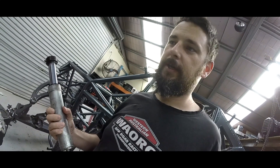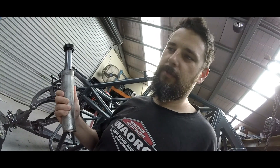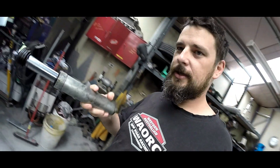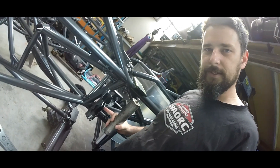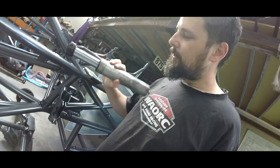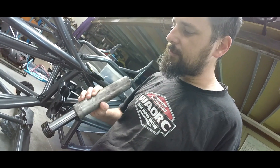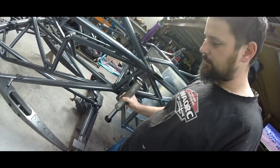You can buy them in different stroke lengths. However, these are some old ones that I had which I'm reusing, and these are 4 inch stroke — okay, this is the stroke here. These get mounted in what's called a bump stop can or canister, which is this thing here. It's just got 2 bolts and it pinches up nice and tight. There's a lip just here so when the bump stop sits up and this is pinched up, it sits on that lip so the bump stop can't go up anymore. On the rear, 4 inch stroke — no problem at all, not an issue there.